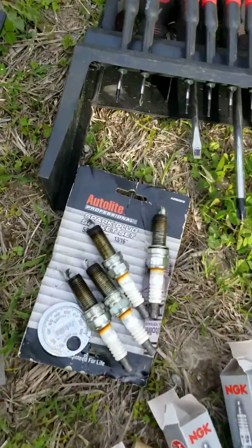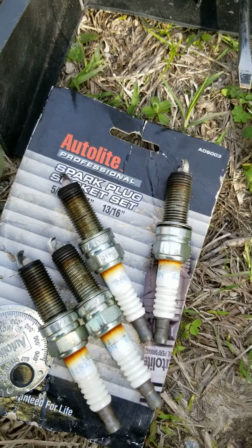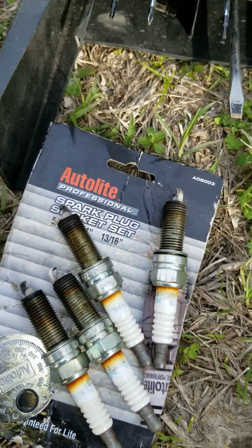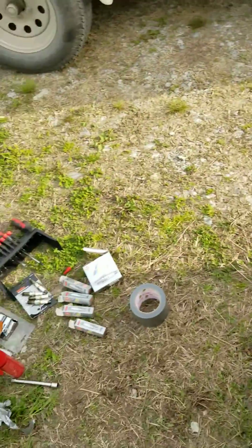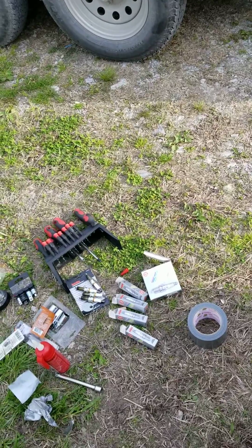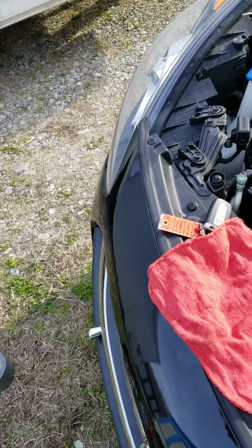As you can see, these spark plugs, guess what? Before these kind of plugs wear out, they'll actually rust. So the electrode's not going to be what you have to worry about. So that's why I say they last so long, and that's why I recommend the tiny bit of use of anti-seize. But make sure it's for spark plugs for light coats, because it's also used for oxygen sensors and stuff. So like I say, that does give you that extra bit of protection.